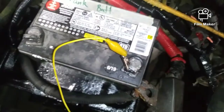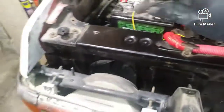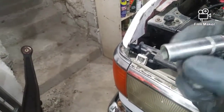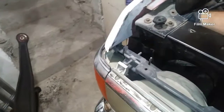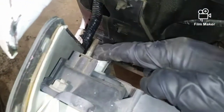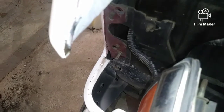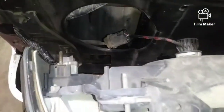You can wait to disconnect your bulbs in the back — it's up to you. If your battery is in the way it'll make it a little harder to remove the bulbs. This is an older truck so there's plenty of room to get your hand back there, assuming you have a smaller hand. What you do is take a 7/16 socket and reach up in here — there's a little nut way back in there. It slides on that bolt right there, pop it off, and it just wobbles right off. There's also a stud down below that the fixture goes around.